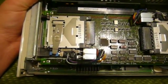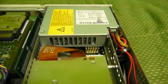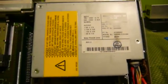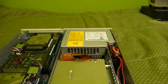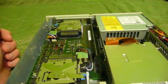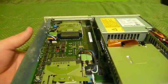I don't have a screwdriver handy, so I can't pull the PC card adapter. Over here is the power supply, and if you put a compact flash card into an IDE adapter, this would be the perfect machine for silent computing because this power supply is completely fanless. It has a whopping 24 watts worth of output on all the voltage rails combined, so it's a little easy to overload. In fact, some people who have put sound cards in these have reported that if theirs has an onboard amplifier and they don't disable it, the playback of a loud sound is enough to cause the power supply to destabilize and hang the system.